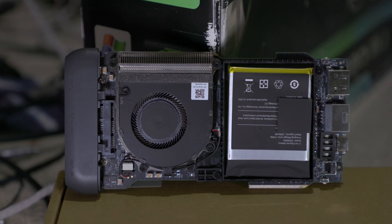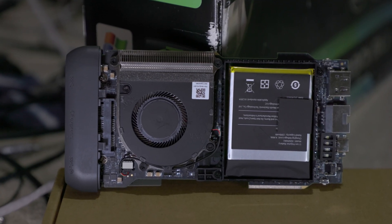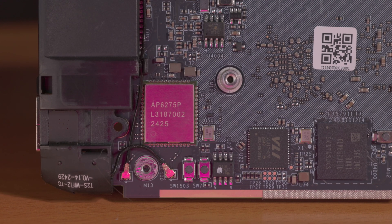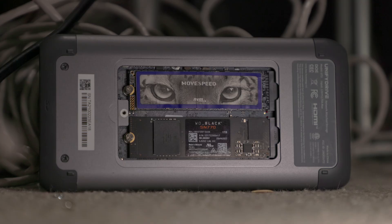In addition to the main SoC there's a Realtek RTL8125, which is a 2.5 gigabit NIC controller, as well as a Broadcom Wi-Fi controller. Looking at lspci in a Docker container I do find a few PCIe switches, which even with the relatively small device and limited IO is pretty hard on these small SoC chips, and is likely why these M.2 drives are limited to probably PCIe Gen 3 x1 connections, or about 1 gigabyte per second.